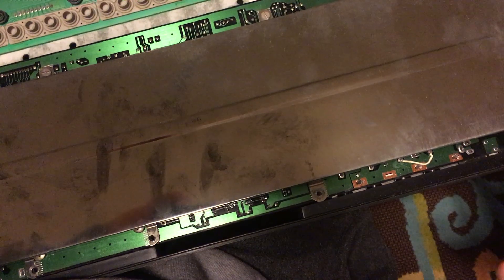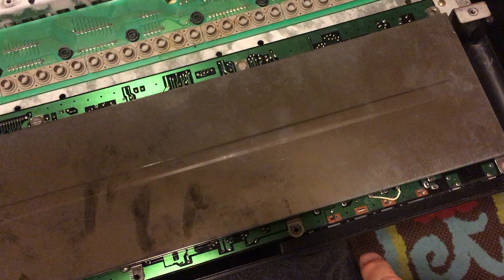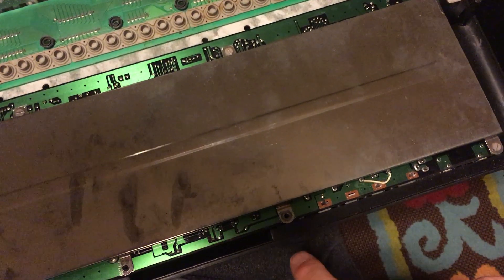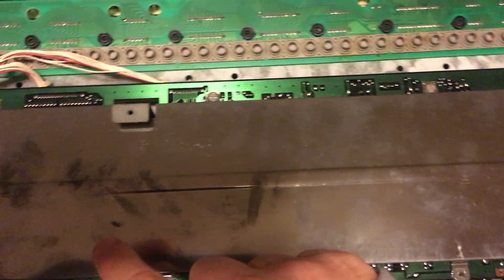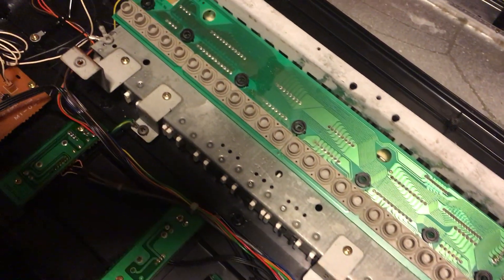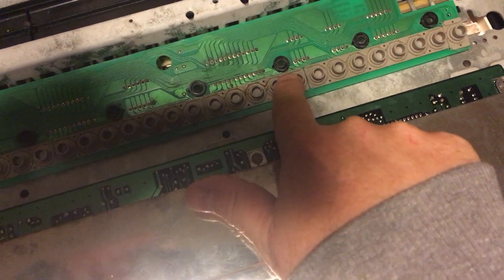This is where the board is. I know there's a battery in here so I'm probably going to open this up and change out the backup battery. Thankfully, unlike many synthesizers of this era, it's user-replaceable — it's not one of those welded-on CR2032 batteries. So I'll change it with a new one just to be safe. Hopefully that helps anyone who ever needs to service these: just get in there, clean up the gunk, and reinsert.